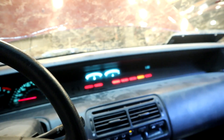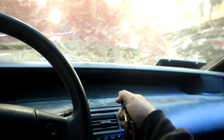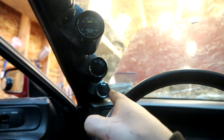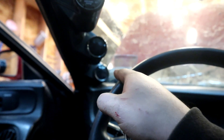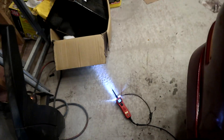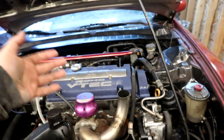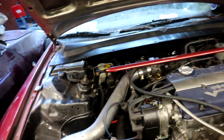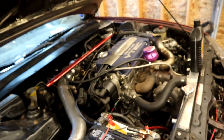The new clamp's on. The oil light's on right there — it's gonna stay on, but I can at least test it. I know the oil light works because it turns on when I do that, it doesn't have a bad bulb, but this gauge always reads zero. I'm gonna ground that sensor out and see what readings I get. As you can see, grounding the sensor out did absolutely nothing — so the sensor is bad, but I know my stock oil light works.